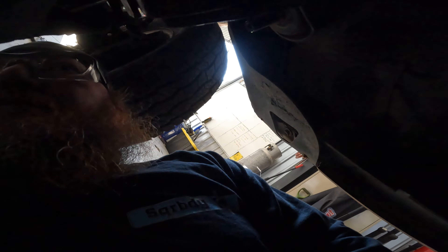The top section is all done - we were able to do that in two bends. I'm going to grab that other bend we made earlier and go underneath. I'll make it come down and away from the engine just a little bit. I don't have the factory exhaust yet so I don't know exactly where to run it, but there's our downpipe so far and it looks pretty good.